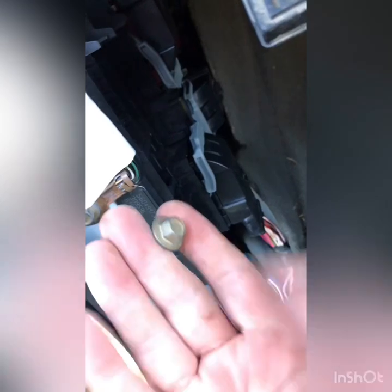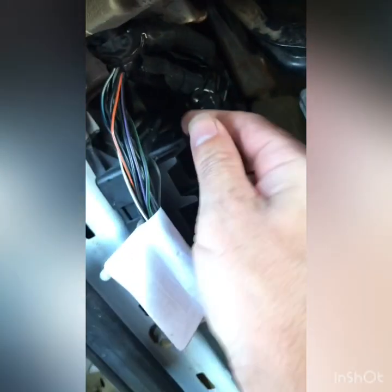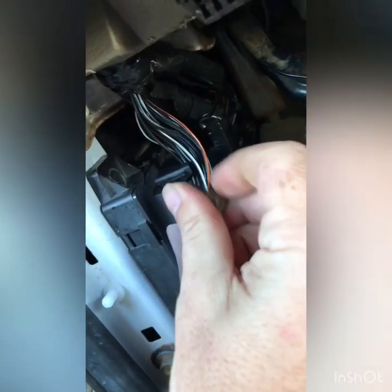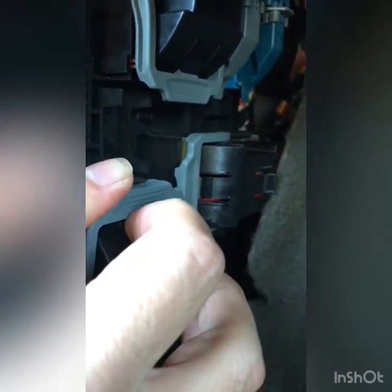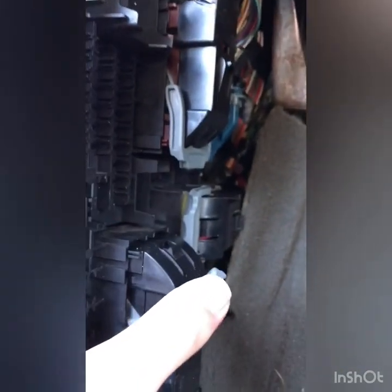See, it slides right in there. I've already broke this one down and dried it out, so it's missing some pieces. After you get to this point, you want to take these screws out. The first one is located here at the top left — it's a 10 millimeter. Then there's one on the bottom center and one on the top right up there. I'd recommend getting an extension. Then you've got these big clips here, and these clips are locked in by these little tabs. You push down the tab and this thing hinges out.